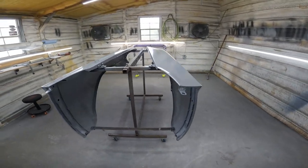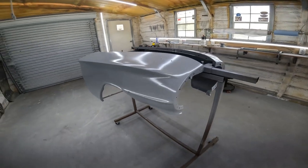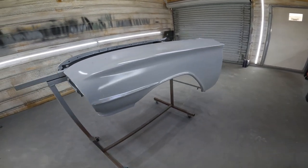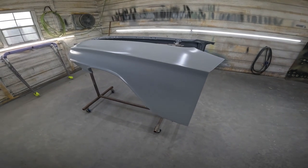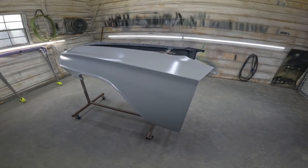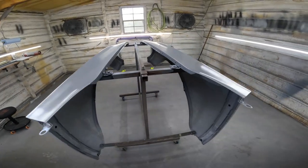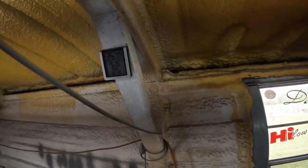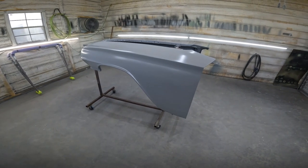Two coats later - two and a half - I mixed up 22 ounces and afterwards I had only one ounce left, so good mix on that. Went a little heavy on the second coat but it flashed off nice and flat. What I'm going to do now is let these fenders sit until Monday afternoon, then come in and spray feather fill directly on top - just like we did the hood and the shell, same process. The top of the fenders look good - that's the main area you see. Still 102 degrees in here, now it's a pizza oven.